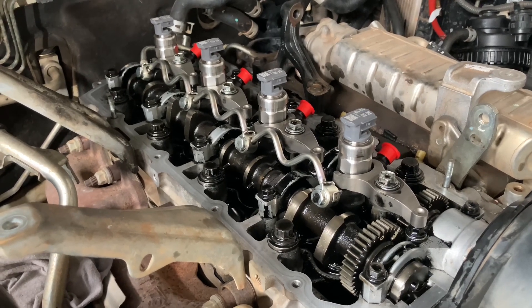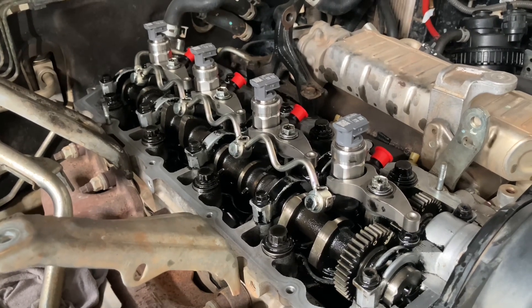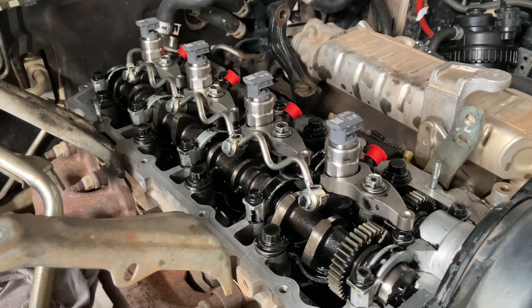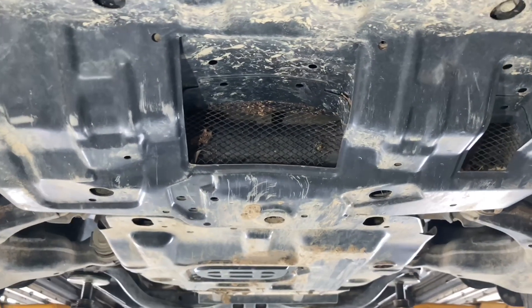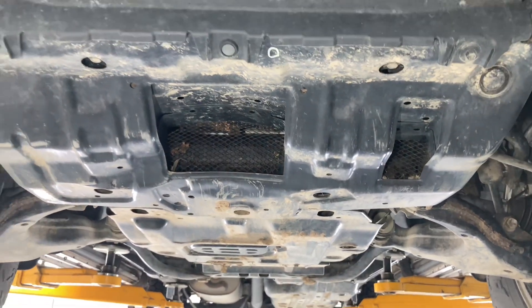The 120s are part DLC - it's a bit confusing, check the injector information playlist. For your Hilux from September 2009 onwards, what we supply will be full DLC. They're going to last a couple hundred thousand kilometres or longer if it's highway kilometres. It's not just about kilometres - it's about age too. If you don't do many k's, they'll last about 10 years anyway, so when you work it out properly it's not really a massive cost.